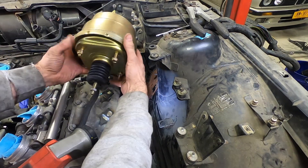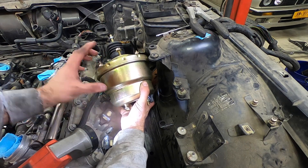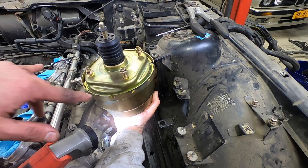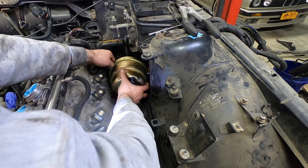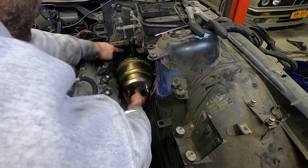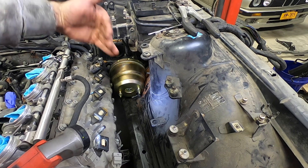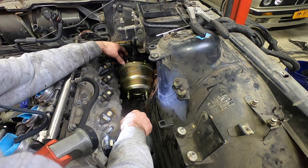Here is a JEGS booster that I bought. It's 7 inches in diameter, a double booster, which means it's a little bit longer but also narrower in terms of diameter, and that allows for slimmer applications like this one. The bolt pattern here does not line up, but that doesn't concern me much — it's just drilling holes to get it aligned. If I were to install it here, it would fit really comfortably, but it's actually about 2 total inches off to the right, and that is not good because now you're talking about a non-orthogonal force hitting the brake booster, and that cannot happen.